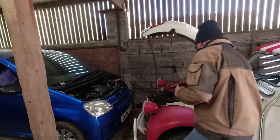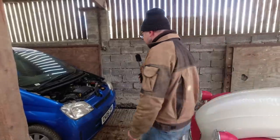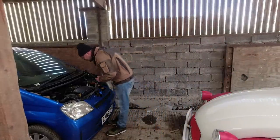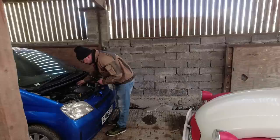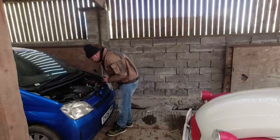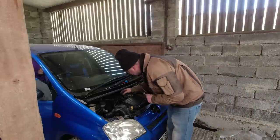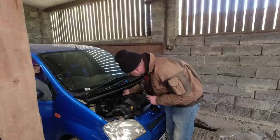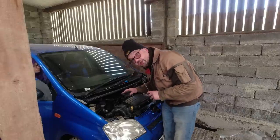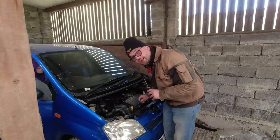Calm down little girl racer. We'll see how we go. Devastating scenes - it's doing this again, why is it doing that? That is not the result we were hoping for. There is exciting news though: if I connect up the throttle position sensor, that seems to be where everything's going wrong. I think it's just running on a default map - it can't detect what the throttle is doing. So we're going to swap that out.